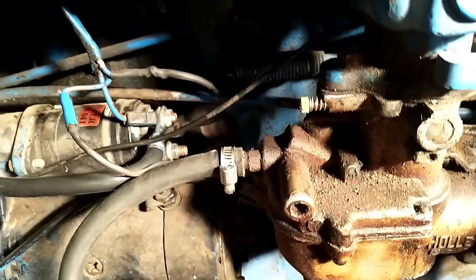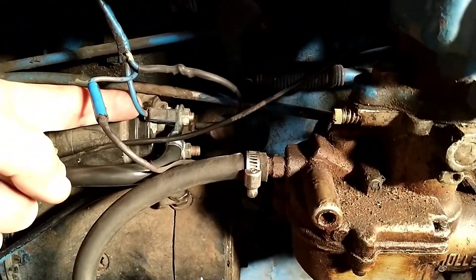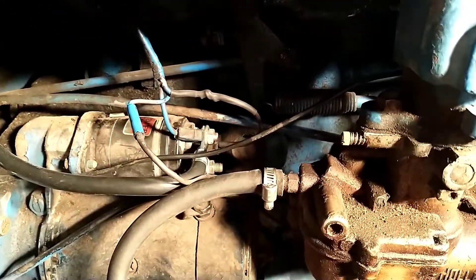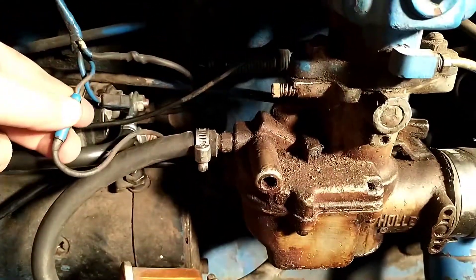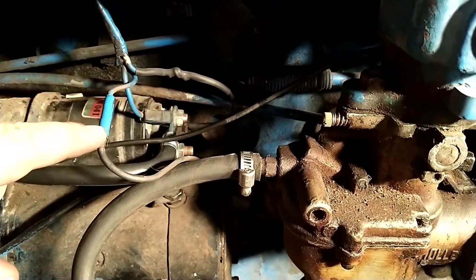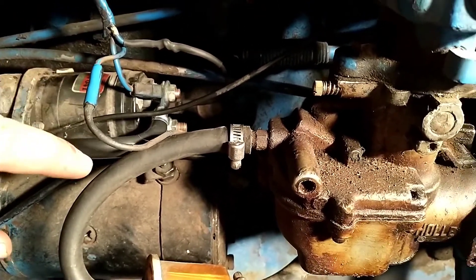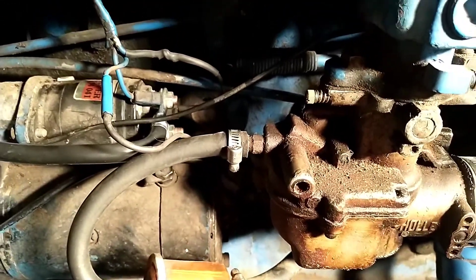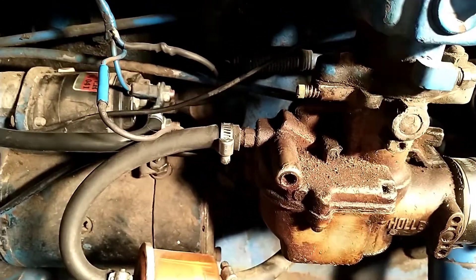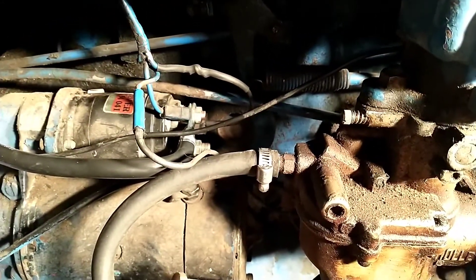What we ended up with — and you can't see it very well because some of these wires are painted — is this white wire with a red stripe. I just put a spade terminal on the end and lengthened that wire a little bit so it could hook in to the starter down there. That's my starter switch signal. And then this wire here — the brown with yellow stripe that I connected up top from the alternator — that's my charging wire. And then this wire here is brown with a red stripe, and that's what goes to your ignition coil — it's hot both when the key is in the on position and the cranking position, so you don't really need the extra ignition wire for this one. Whenever I fired it up the first time it just clicked a couple times, and I believe I just had a loose battery cable. I got that tightened up and it seems to be working fine now.